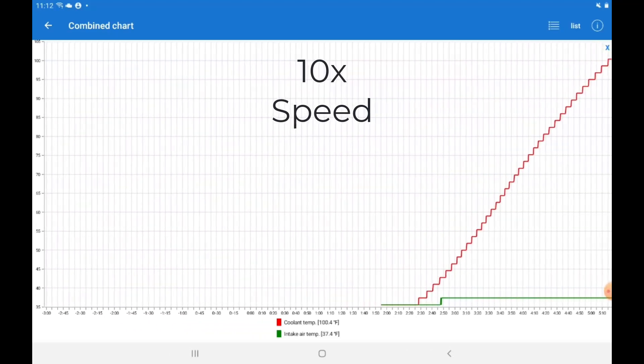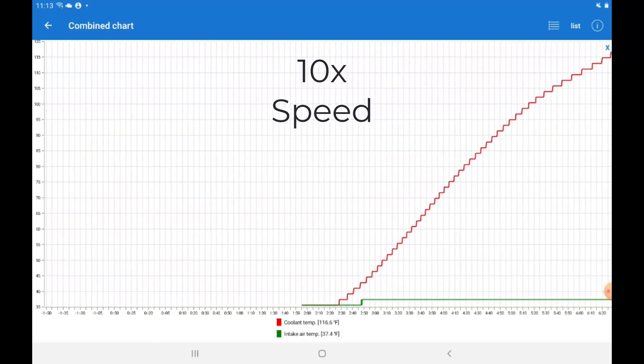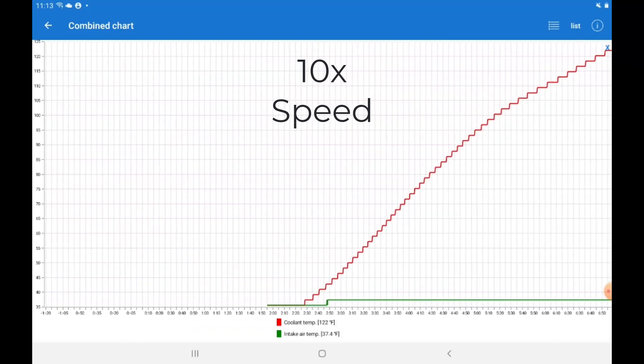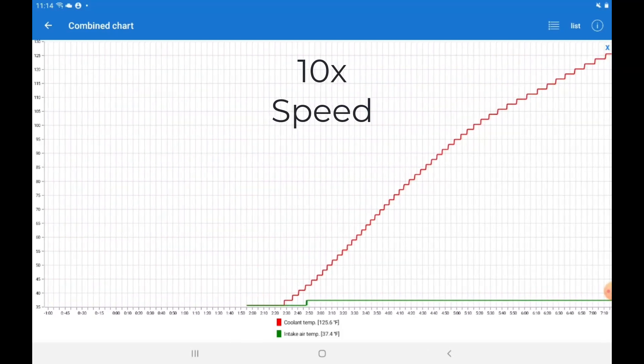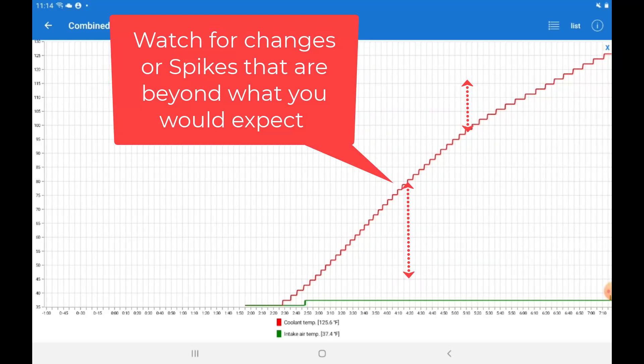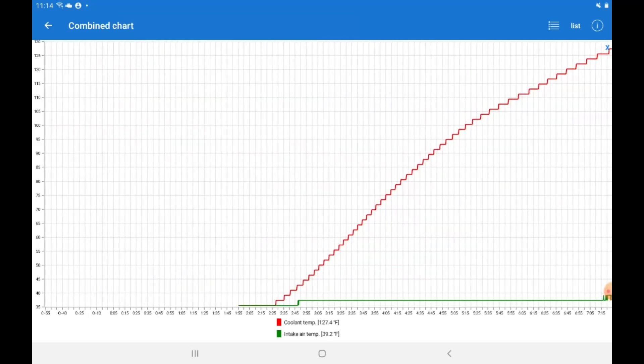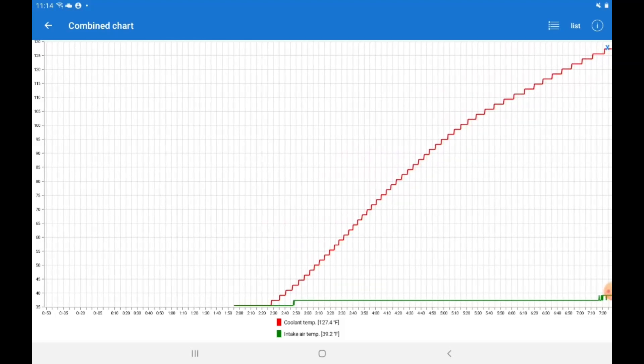The main thing I'd want to watch out for is some crazy drops or spikes in the temperature — for example, it's at 100 degrees and all of a sudden it drops down to 40 degrees and then back up to 100. Something that looks abnormal, because your coolant temperature is not going to dramatically change that much that quickly. That could signify a loose wire or something, or any weird spikes in temperature. As you can see here, this is looking normal — a steady rise in the red line as the engine's warming up, which is exactly what we'd expect to see. Without popping the hood, we can just look at our OBD2 reader and say the engine coolant temperature sensor looks good on this car. It didn't start off crazy high or crazy low. It looks like a normal range.